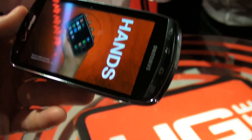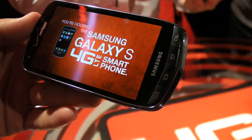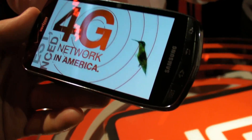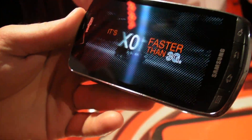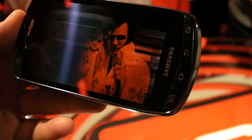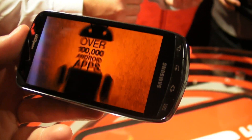The Plus screen is basically a 50% increase in the sub-pixels, which makes it a little bit more clear, crisper. The video is going and you can see that. The resolution itself is still traditional 854 by 480, but you have more sub-pixels — 50% more sub-pixels. Instead of having 8, they have 12. So that's what's giving it that cleaner, crisper, better colors.